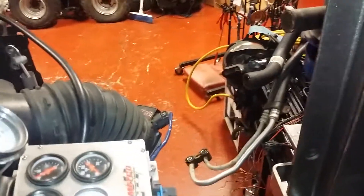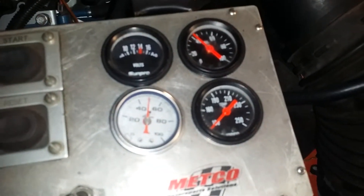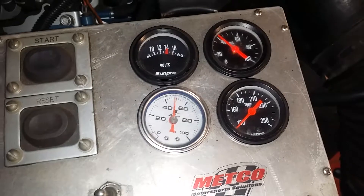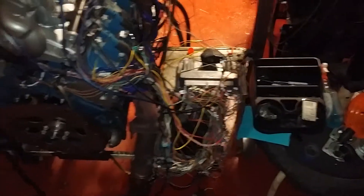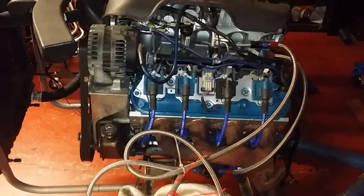Let's see what kind of voltage the alternator is putting out. She's struggling — there we go, that's the IAC working, learning again. Alternator's working good. Fuel pressure's good — fuel pressure's always been low like that every time I've done an LS build using the Aeromotive gauge. I might have to verify that, maybe put another pump in there, figure out why that's always like that. Maybe that's why I have such a rough idle, because the computer only thinks it's seeing roughly 58 psi. It has no way of actually measuring fuel pressure — it just assumes it's already there. That's one downfall of using the factory GM computer.